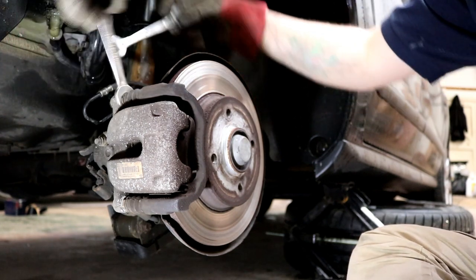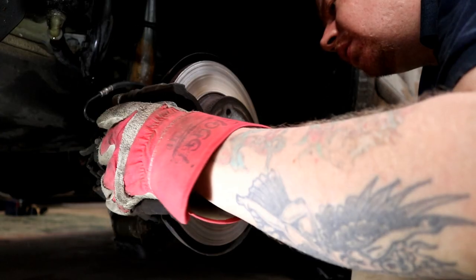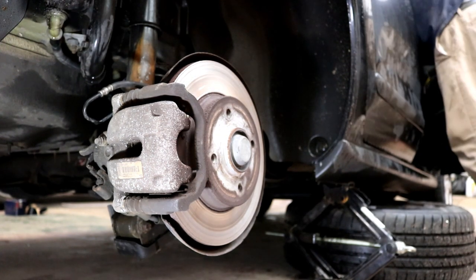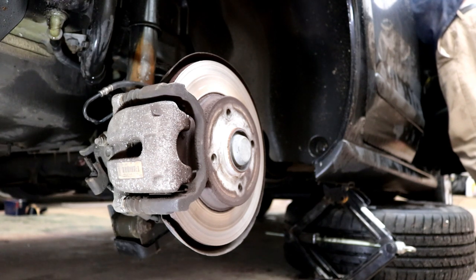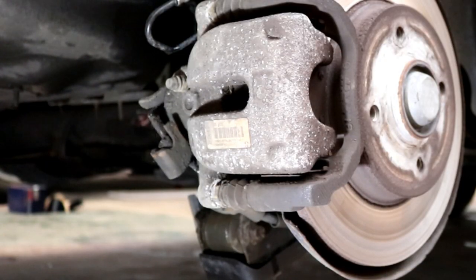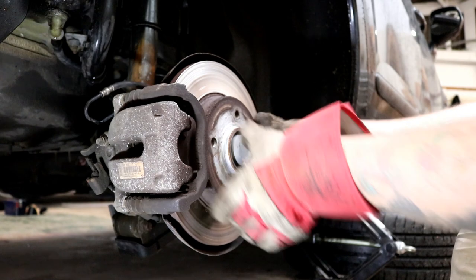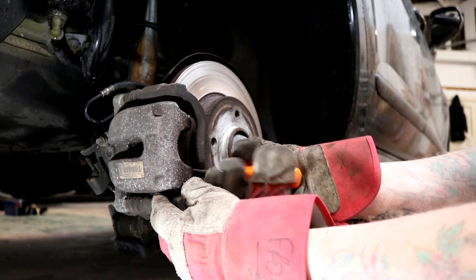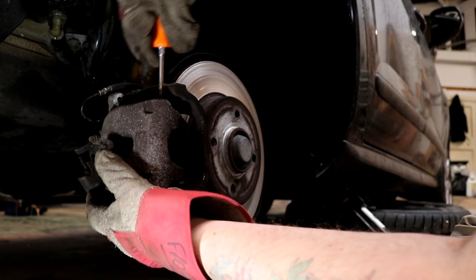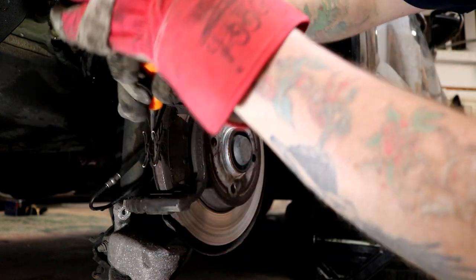Just like that it's coming off. Here we are — you can see the automatic handbrake, which you get on a 3008. I'm disengaging it now by starting the engine, and you can see the brake release when we deactivate it from the dashboard. This is where you really have to make sure your front and back wheels are chocked, because I don't have axle stands — that's why I put that wheel underneath the car, just in case it rocked back or forth and dropped off the jack.